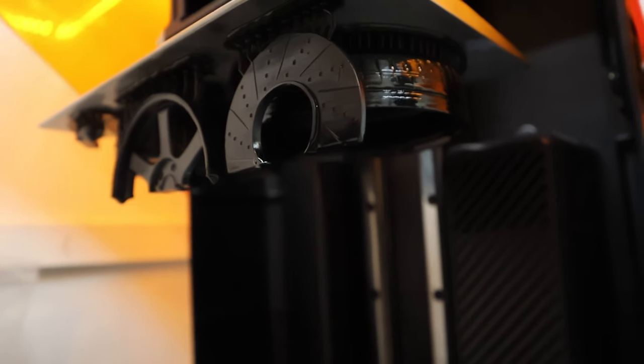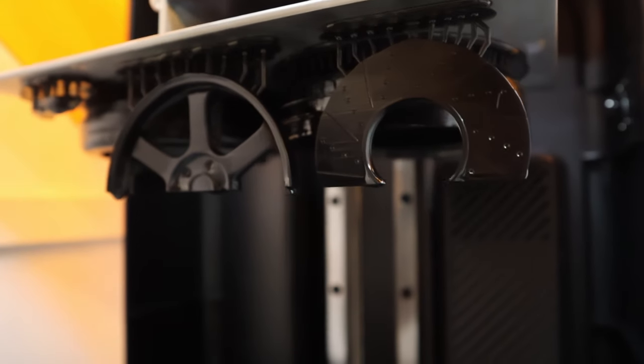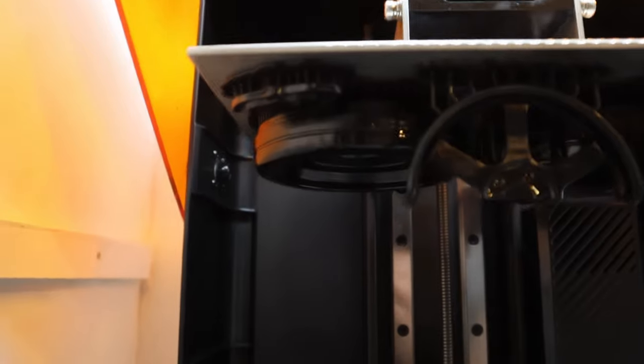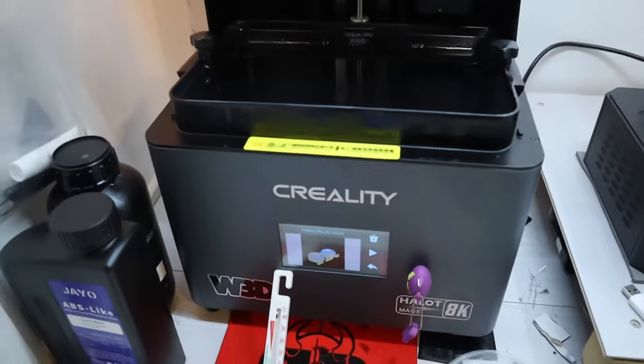Now you'll be looking at it thinking, it looks a bit broke, mate. And it's been in here probably now for about a week, 2 weeks. What happens with these 3D printers is quite interesting, and you need to know this. Basically, with these data sticks, it needs to be FAT32. When you format it, they need to be FAT32. They can't be NTFS or something like that.